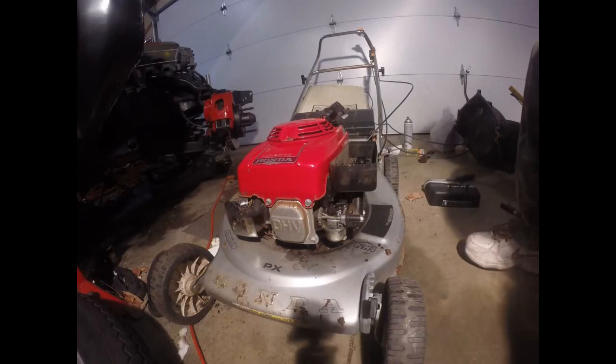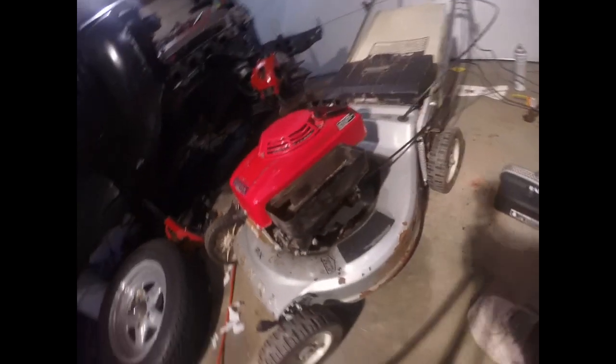I got a new lawnmower. Well, I got some decent lawnmowers, but maybe I could sell this one for $5 or $10. But yeah, that's all it was to it. Clean that carburetor up a little bit. I think it was that on and off switch tube that was going into there. That was really blocked, and that jet was really blocked, and the bowl had a lot of garbage on it. But there you go. Someone threw this out.